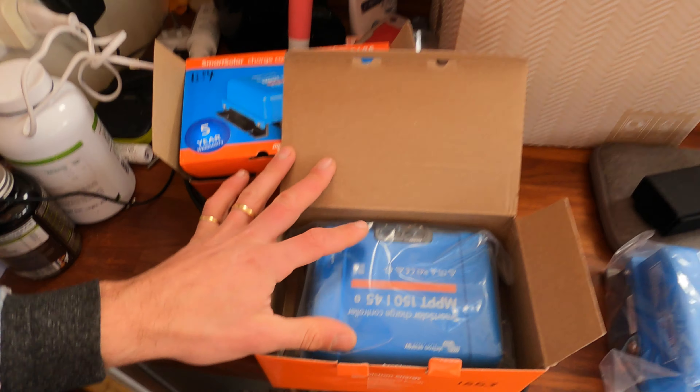And then the moment we'd all been waiting for — the solar panels were finally connected. Good morning. After months of waiting I have my MPPTs, and I've got some wires coming through all the way down the boat. There were a lot of things that had to be ticked off in terms of getting the wiring through, but we're close to getting the solar connected. I've got all the wiring done — I have to turn off all the electricity. So I'm just going to turn that back on now, turn the batteries back on, and hopefully my MPPTs will snap into life. Then I can flick the switch and connect solar.